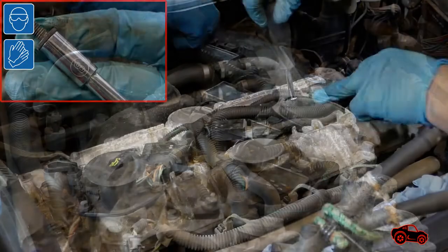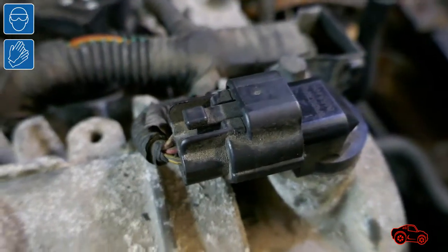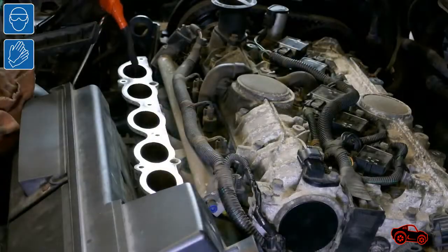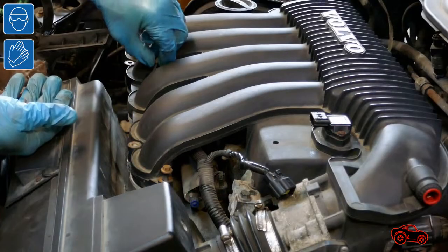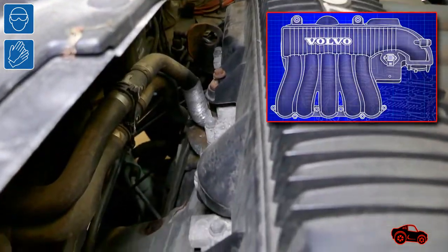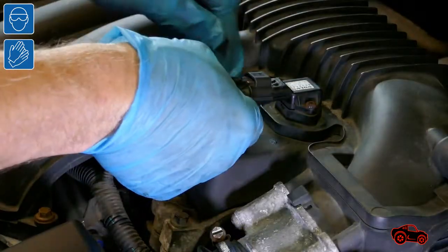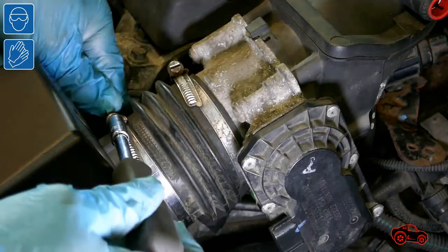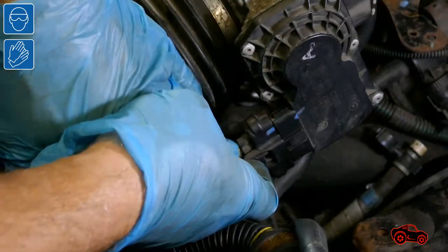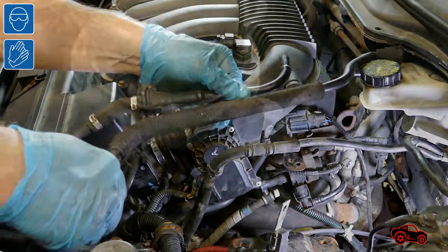I reconnected the five coils, the two ground eyelets, the VVT solenoids, and the camshaft position sensor. Before installing the upper intake manifold, I vacuumed the lower intake manifold. Next, I carefully positioned the upper intake manifold and the retaining bolts — six in the front and two behind — then tightened the bolts to specs. I reconnected the intake manifold pressure sensor and secured the wires. I installed the throttle body flexible hose and reconnected the plug, refitted the rubber hose under the upper intake manifold, positioned the vacuum harness assembly, and reconnected the four branches.